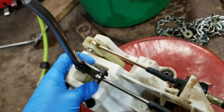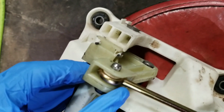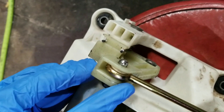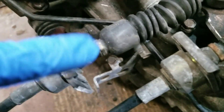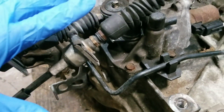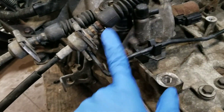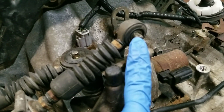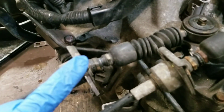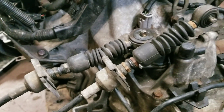Put your shifter in the neutral position, just kind of where you think it should be centered. There are two pins - if you move it one way or the other it shows you where it should be in center. Once it's pretty much centered, measure from here to here at a common point so you know where this shift linkage should be centered. On mine, for this cable, from the face of this to this tab, it's around five inches, and on this one it's five and three-eighths.